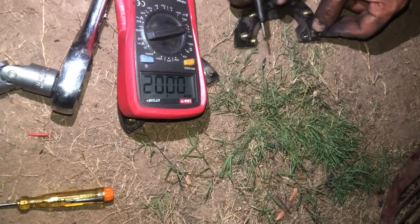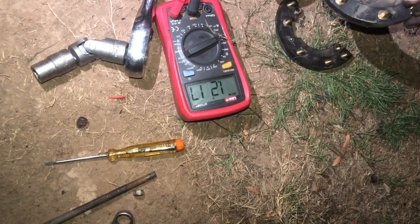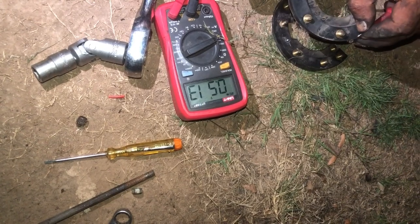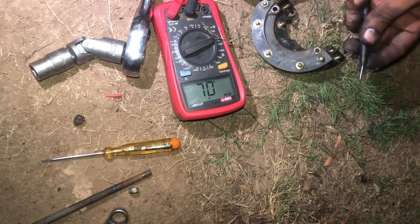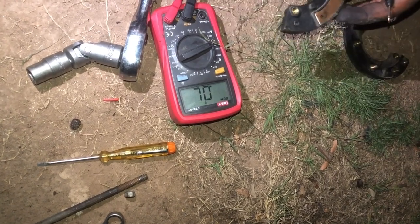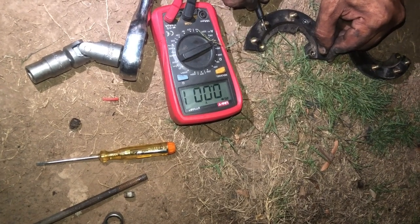During the positive half cycle the positive current is output, and during the negative half cycle the negative current is output — both measurable at the negative and positive output of the diode bridge. As you can see, we are repeating the testing process. With the negative plate, all the diodes are showing resistance of 0.02 to 0.03, which means those diodes are shorted. On the positive side, two diodes are okay and one is faulty. With the help of the multimeter it is verified that four out of six diodes are faulty, so we have to replace the complete diode bridge.